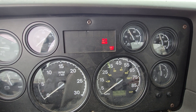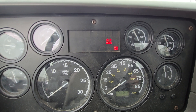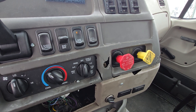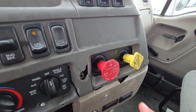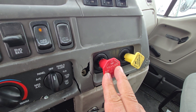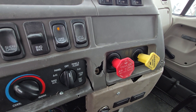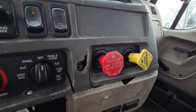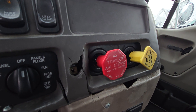Next I'm going to check the emergency brakes pop out test. I'm going to continue fanning the brakes to see when both protection valves pop out — both of these should pop out between 20 and 45 psi. I'm going to watch the valves closely because sometimes only one valve will pop out. If that happens, we'll stop pumping and say what the pressure is when that valve pops out, then continue pumping until the next valve pops out. Or if they both pop out at the same time, we can just say what the pressure is. It's important that you watch the valves to know if a single valve or both pop out.